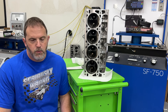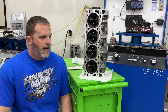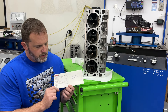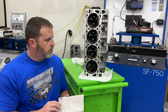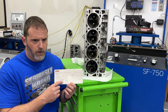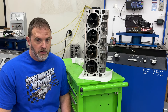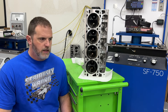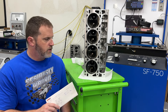I want to talk about something from the last video - it was about the difference between the camshaft for the small block Chevy and the LS dyno mule. One thing I didn't do a good job explaining, based on the comments, had to do with the cam card itself. I should have been more specific and said that this is all based on the tappet - the movement of the lifter - and I kept referring it to the valve, which isn't entirely the case. I was really trying to deal with just the cam card, because that action is from the cam.